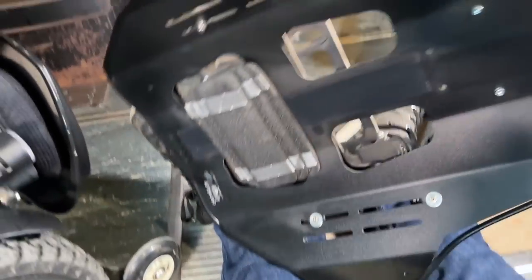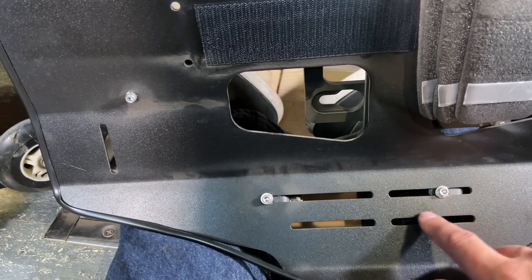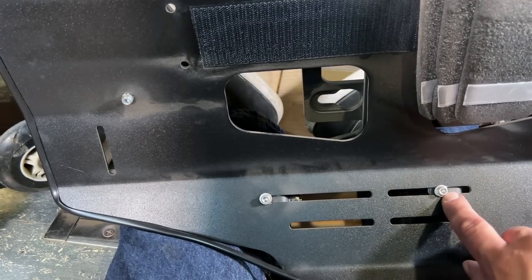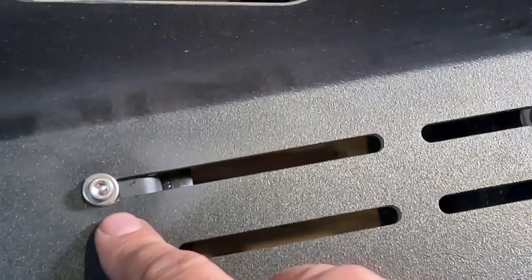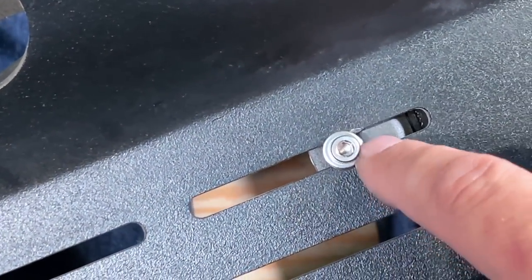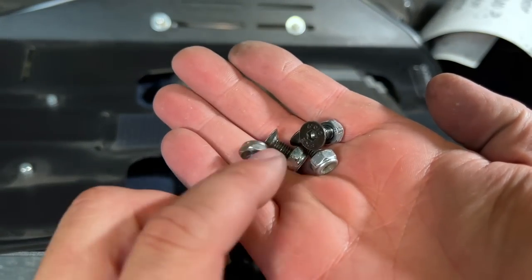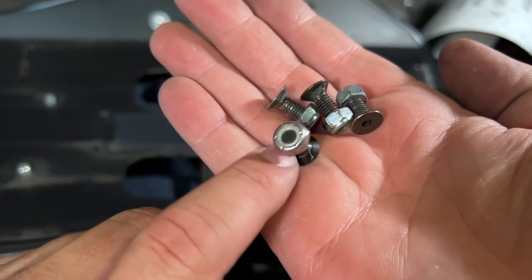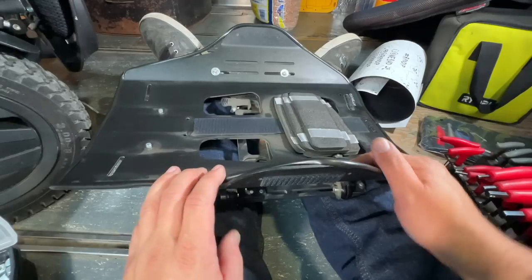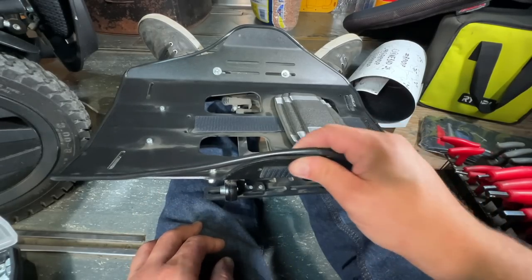This will work for now. It's sort of dented the washers a little bit, but these are nylocs anyways so I don't think they're going to come out of here. We've got this thing properly attached now. On this side, because the bolts weren't long enough, I used two smaller washers stacked appropriately — stainless washers have a flat rigid edge on one side and a little dome on the other. They are very tightly gripped. You can see we've got a good bite on both sides and they kind of dish out, which keeps them from rotating. Those skid marks are from the old hardware. They actually used different size nuts too.